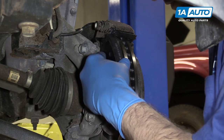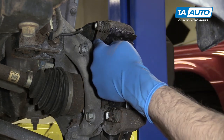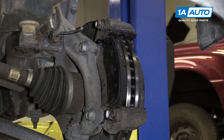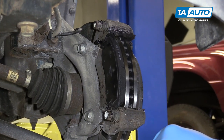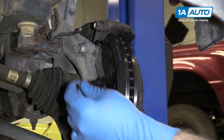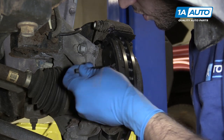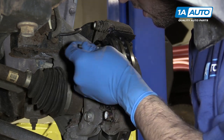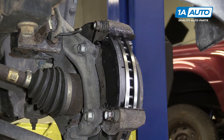Install your brake pad. I'm placing the rear one with the squealer at the top just because that's how it came off of the vehicle. Sometimes they will interfere with the caliper if you place them in certain ways, so I like to just put them back however they came off. We'll apply a thin coat of grease to the back and do the same thing with the pad on the front.